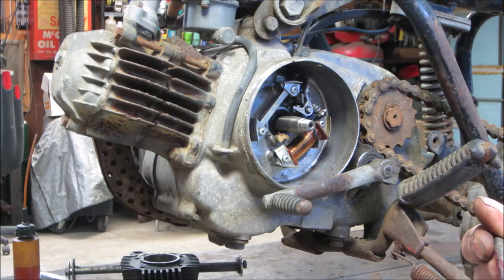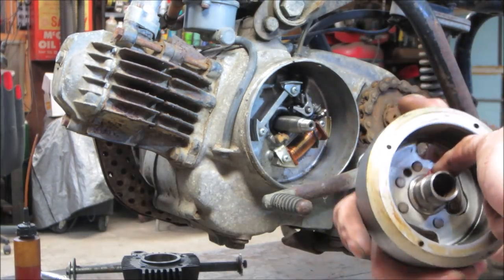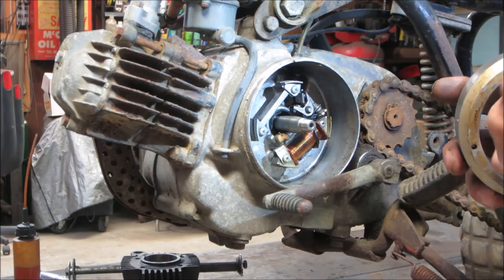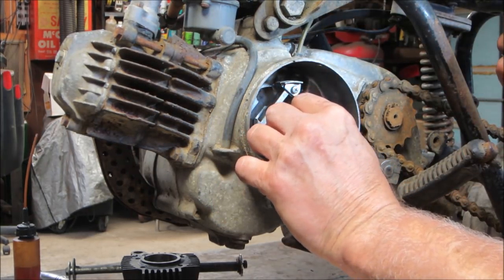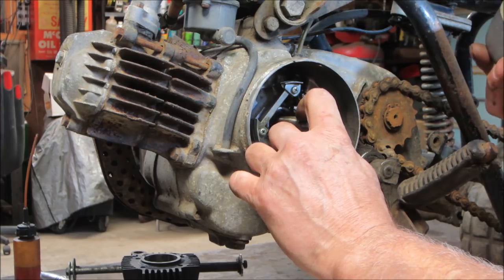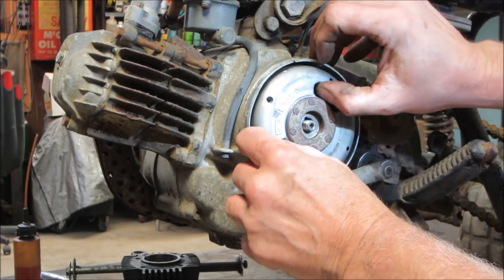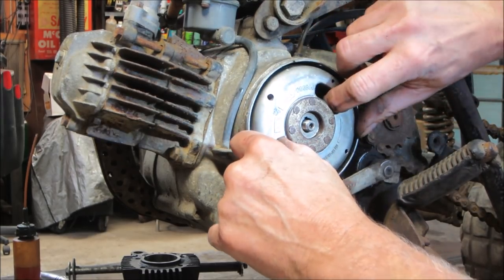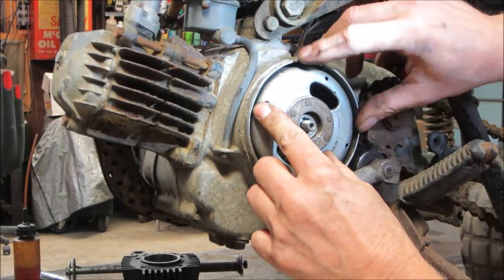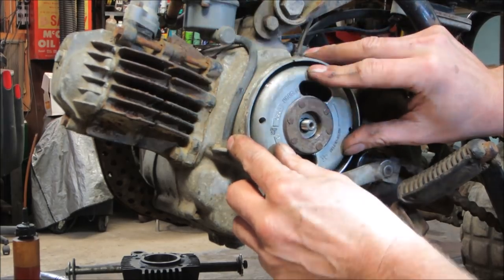Let's clean that off and get ourselves a little bit of grease. It'll spread itself out anyway. You don't want too much though — you don't want to get anything flung up onto the point. I guess that pin is our key. That's top dead center right there — that mark and that mark. You got to get in there in that groove. You guys can see that opening up a little bit. I'm going to tighten that down. Timing mark should be there — that's where our points should be open.